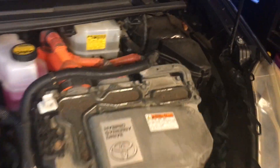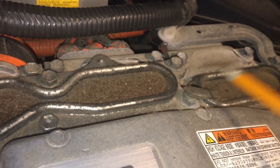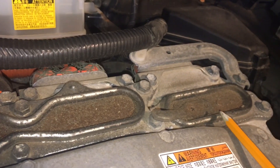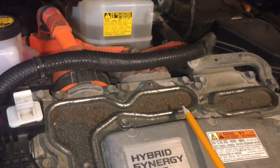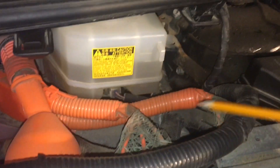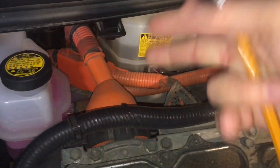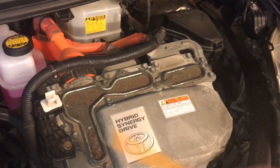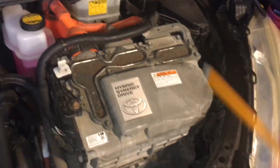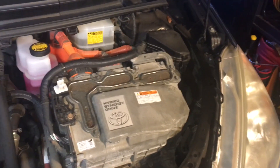I'm not qualified to tell you all that — I was only here to answer the question: why is that tab there? There's nothing fancy. It's just a simple mechanical sequencer forcing you to remove this panel first, because this is where the interlock is. If that tab wasn't there, there would be the potential to remove this connector directly. Behind here is the MG1 and MG2 and the frame wire — this is the DC high voltage coming in from the battery to provide the inverter with its power. So that's it. Nothing really too fancy about the answer, but there is a wee bit behind it.